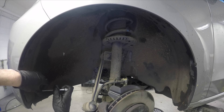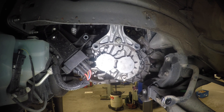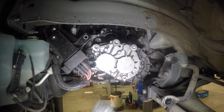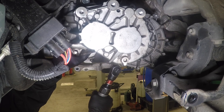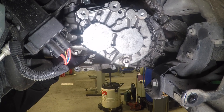We're going to remove the wheel arch liner — my camera died here so I didn't get the footage, but you just undo all the T25 bolts and it drops out. As you can see, there are three 16mm bolts that hold in the gearbox mount, and with those three removed we have clearance to drop the gearbox out. We lower the gearbox to clear the side of the vehicle, remove that remaining 16mm bolt we left in earlier, then push the diff end of the box up and it will drop out of the vehicle.